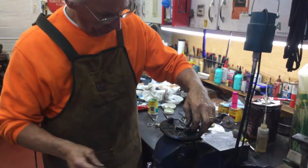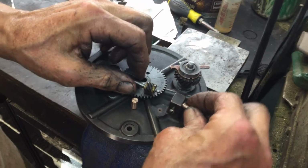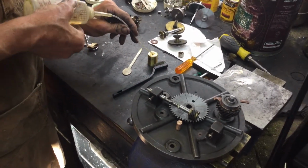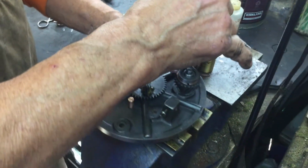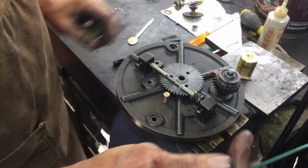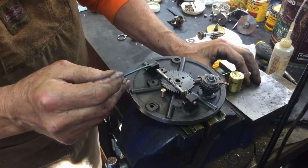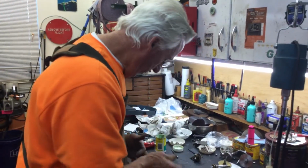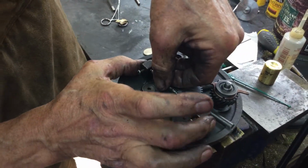So what we'll do is we'll take the shaft and stick it through there like that. See how I pop this in now? We will take one of those, the illustrious Starbuck part. We will put one drop. You see how I put one drop in there? And then I will slide that one in there. And now I will push it forward a little so everything's stuck together. And I will do one drop on that bearing. I use my little Starbucks stopper thingy for the oil. Now you would put both fingers on the outside of the bearing and put it together.